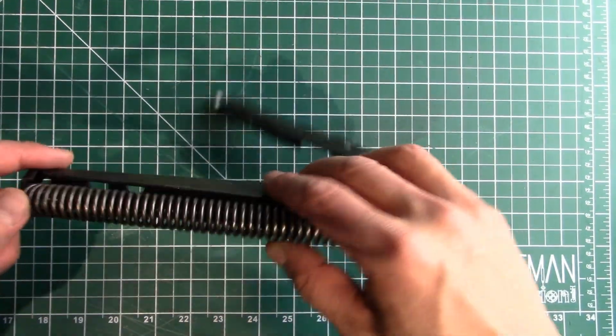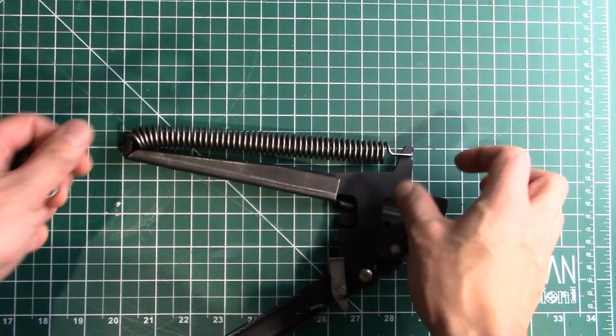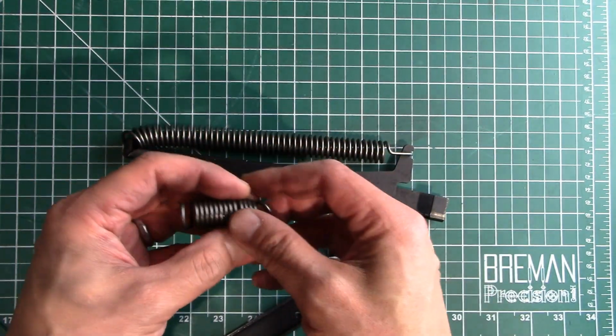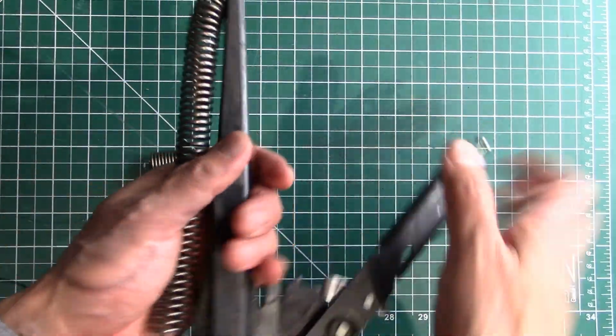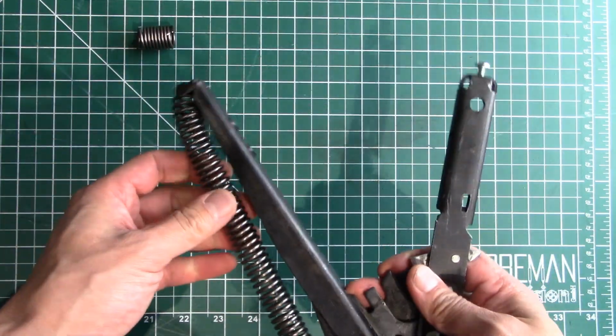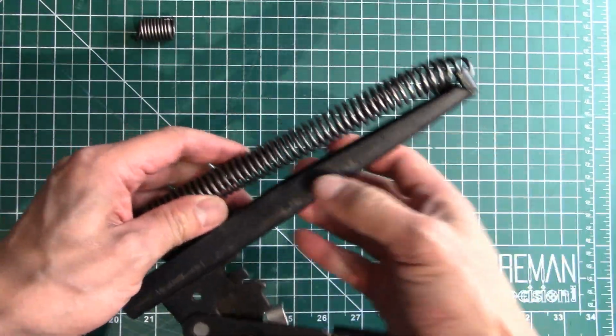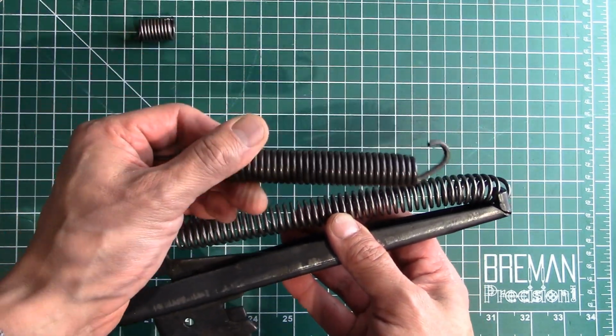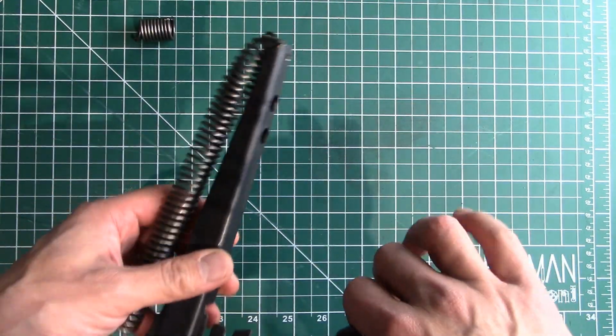All right, so I think I got that spring cut down. Now, surprisingly, I actually had to remove quite a few of the sections of this spring just to get it to have the right feel of tension. So I think the spring constant on this steel is maybe a lot lower than the original spring constant. But anyway, it feels okay.